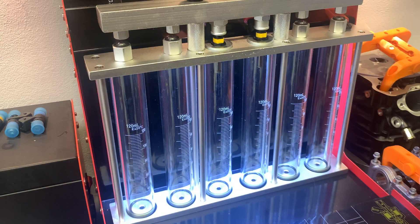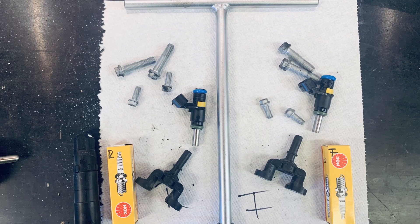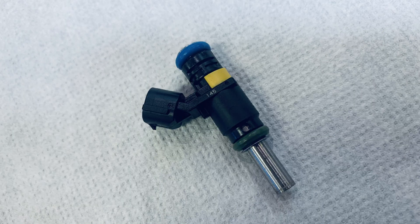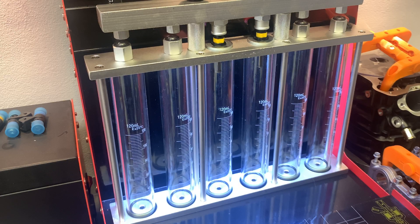What we see now is that the left injector works — we see that it has less volume than the other one, but it works. So all is fine? No — let's not put it back on the bike, because there is still something wrong. Earlier we saw nothing coming out, so it could just be a clogged injector that needs to run a bit and be cleaned up. But in this case, that is not the problem — in this case we have an electrical failure.